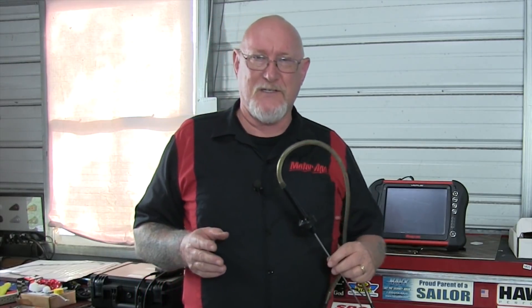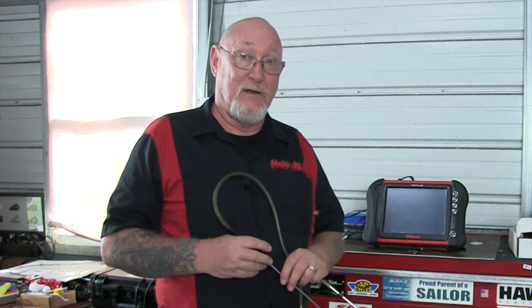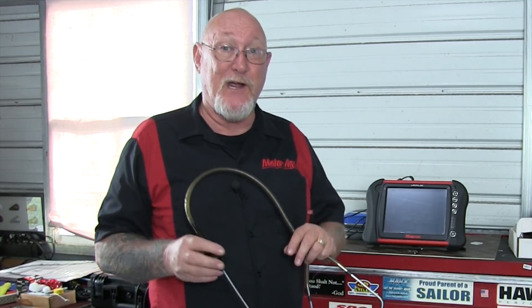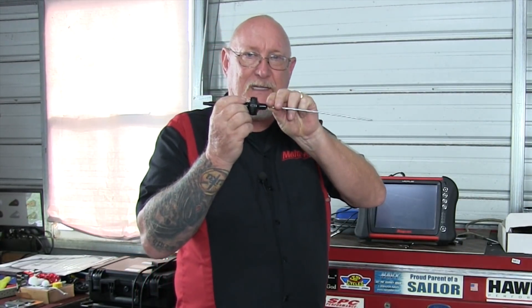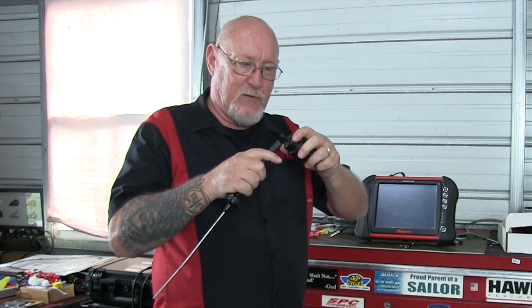Now, just a quick note: this is going to be a little unusual from the trainers you've seen me do in the past. This is not a proven and practiced technique — this is something we're kind of playing with to see just how well it might work. So let's go ahead and make the tool we'll need. We're going to take our mechanic's stethoscope, remove the earpiece part and set it aside. We want to make sure that rod is nice and snug and not loose. Then we're going to take a short piece of rubber hose, attach it to one end, and then attach the other to our sensor.